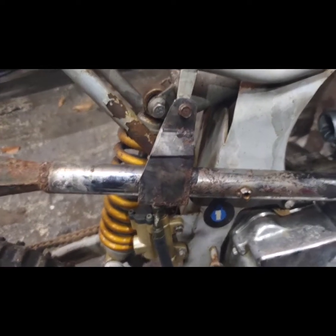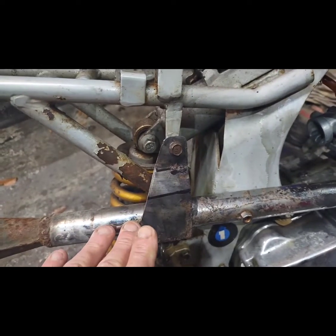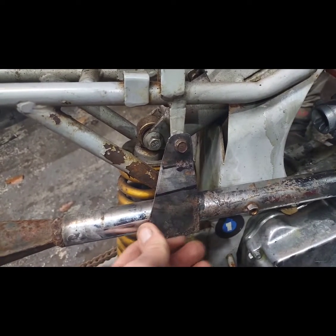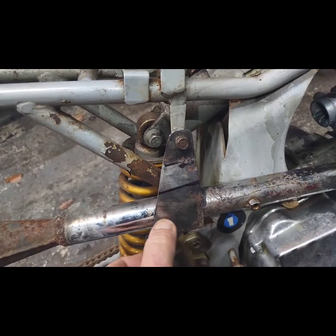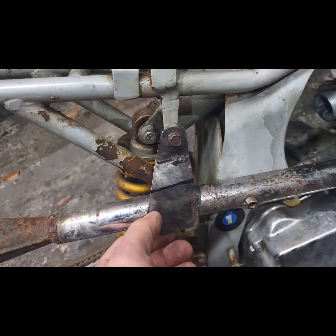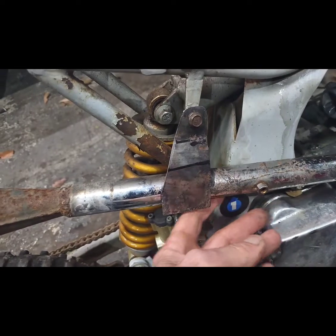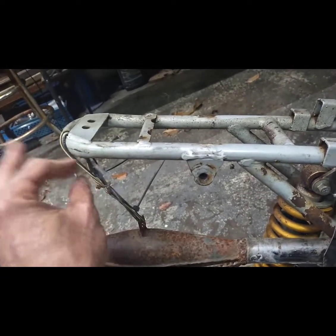Here's what I got figured out for the exhaust bracket. I cut my bracket and did a little stylish swoopy on it, and I'll bend it out here a little bit and bend it back in so it comes in with the muffler. I just need to tweak it this way so it lines up good, then I'll strike a line across here, cut it, and weld it to the exhaust pipe. Once it's in I can bend it a little so it's not tapping on the frame, and we can cut the speaker wire nightmare going on back here.